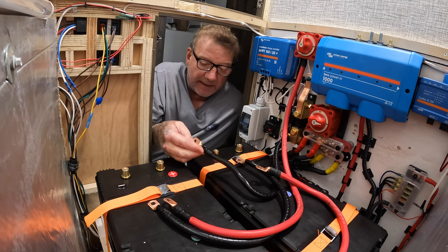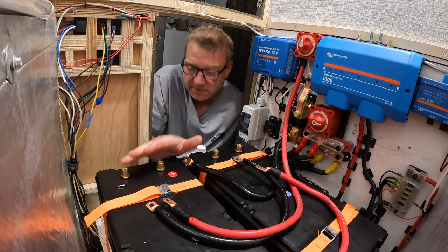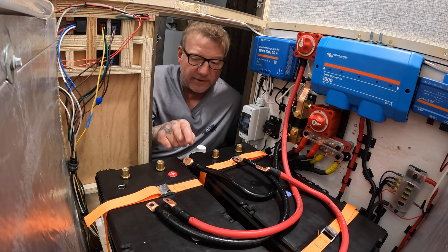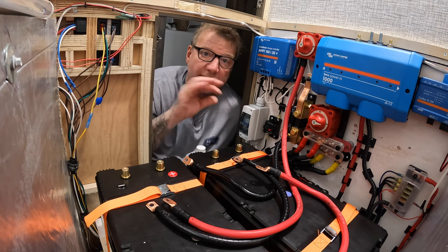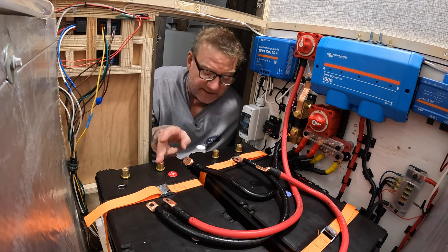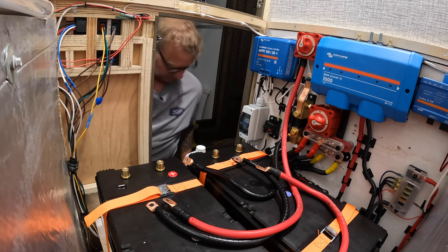When I say 'main,' I'm talking about the main feed going to my system. It's going to go against the post, then the jumper will go from there. I lightly sanded all my lugs on the bench and I'm going to wipe them down with rubbing alcohol — just to take any oils off and clean them up as best I can before I start making the connections. This is going to be the positive from the batteries to my system, and I want that fuse on it.